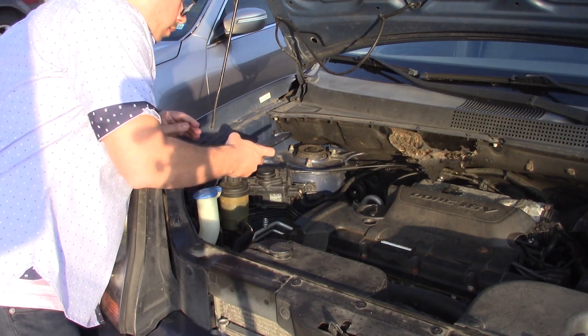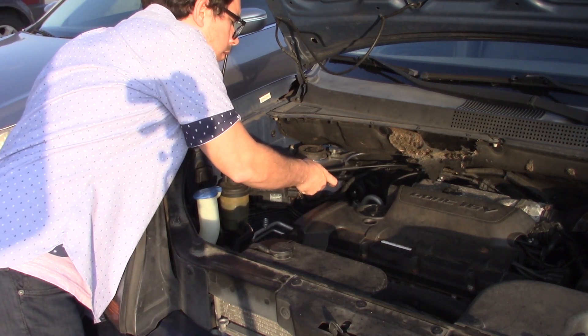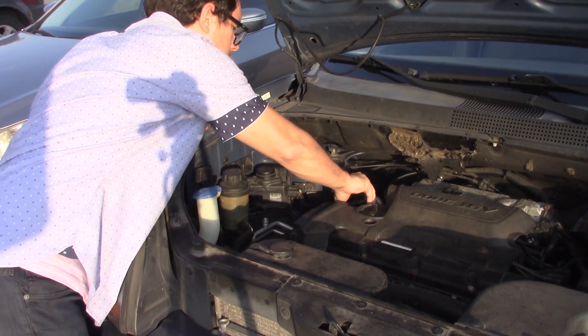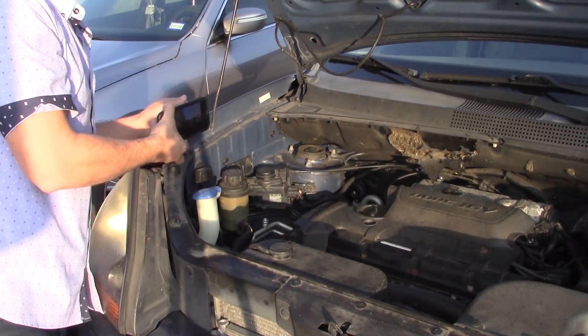You can do this by taking a look at pictures or by using a combination of text and pictures. About the pro tip mentioned earlier: if your compressor is still on the vehicle, use your phone to take a picture of the compressor and all of its features before doing your search online. This way, when you do find the correct compressor, you can verify with the picture online versus the picture you have just taken from your vehicle. Remember to capture all the critical features — the mounting, a good image of the electrical connection, and if you can take apart the electrical connection and take a picture inside it, even better.